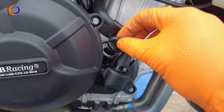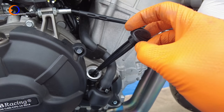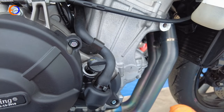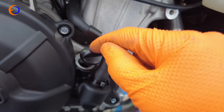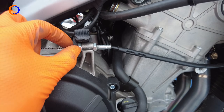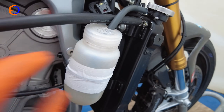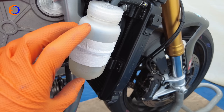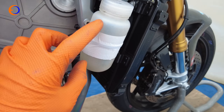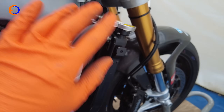The next thing to do is check the oil level on the dipstick. I'm also going to check that the o-ring on the dipstick is in good condition because I've had an o-ring weep around here before and had to pull in thinking we were leaking oil. Then re-lockwire it to a solid point, check there's enough slack in the clutch and the nuts are tight, and check the water level to make sure the radiator is full and we haven't got a full catch tank. If the catch tank is really full it often means the head gasket is leaking — especially flat out down the end of the straight they'll sometimes blow a little bit of water if the head gasket's no good or the radiator cap isn't high enough pressure.